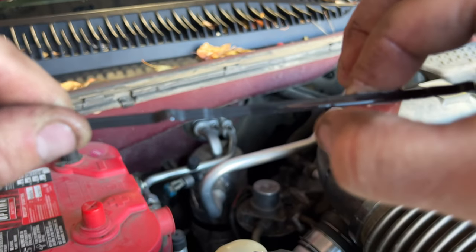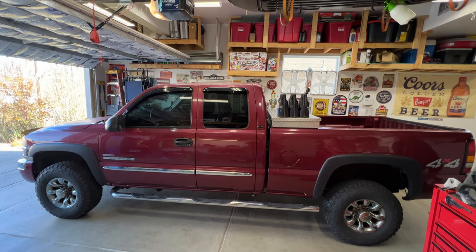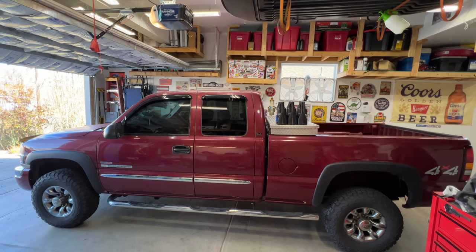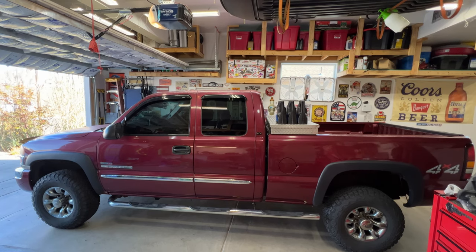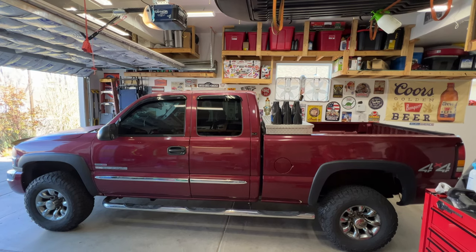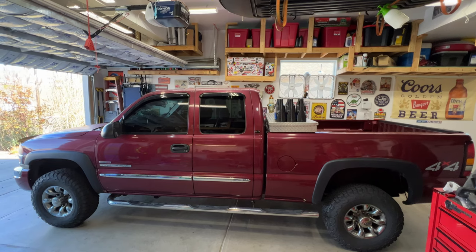That's going to do it for the video. This was a 2005 GMC Sierra 2500 with a 6.6 Duramax diesel and the Allison transmission. I replaced the internal transmission filter along with the external filter and new transmission fluid. All in all, I ended up using right at nine and a quarter quarts — yours will depend on how long you let it drain and the temperature of the fluid. You'll be safe buying just three gallons of that fluid. Hopefully this video helps you out — if it does, subscribe to the channel, check out some of my other videos, and I'll see you next time. Thanks.